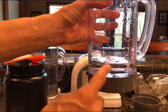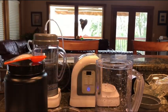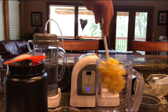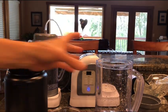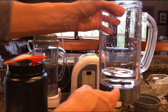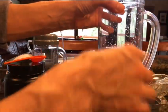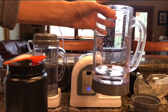When you're done with it, when you dump this water out, make sure to really wash the pitcher with a soft sponge. Only use water — don't use any salts, don't use any detergents. I just use one of these from the dollar store, fill it with tap water, and make sure to get all the sides. Make sure to really rinse it out super well — I'm talking like 10 to 20 times — keep rinsing and swishing the water to make sure to get any citric acid residue out of there.